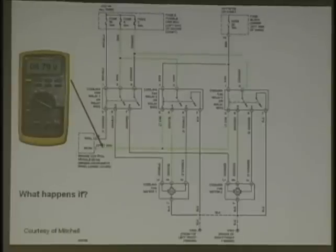Comment here, guys. If you had 10 volts, a 2 volt drop on the lead side, and you have an almost 7 volt drop on the ground side, what you really have is the difference. The difference is what those voltages are on that chart. And you've only got 3 and change volts.